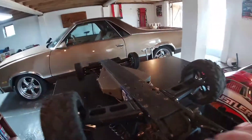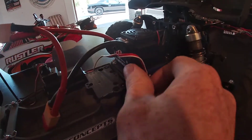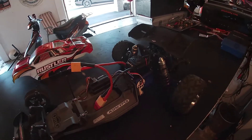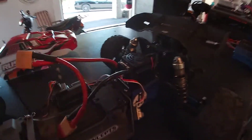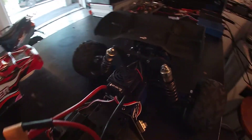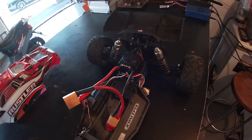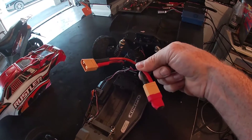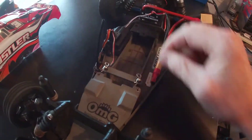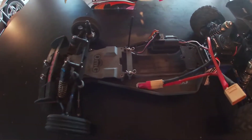The other thing we've done is put in these metal drive shafts — they did everything we needed. We've extended it in here with a few screws, and this sneaky bit here is an ice cream container, and that's what you can do on the cheap. It gives you a handy place to mount your ESC — that's a Hobbywing QuickRun 150A, a great little thing. We can run it on 6S but mostly just have the jumper in there and use 3S, which fits nicely in the battery tray.